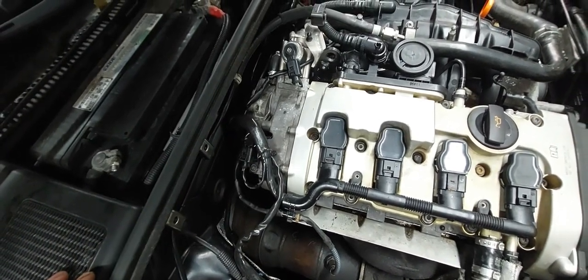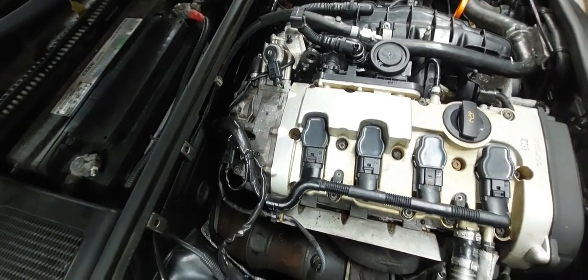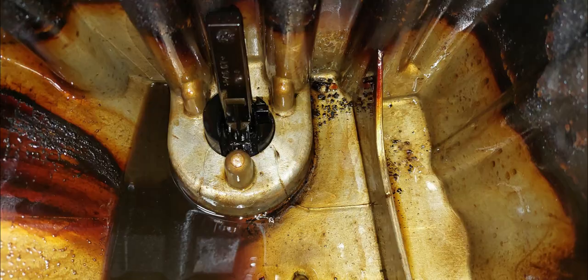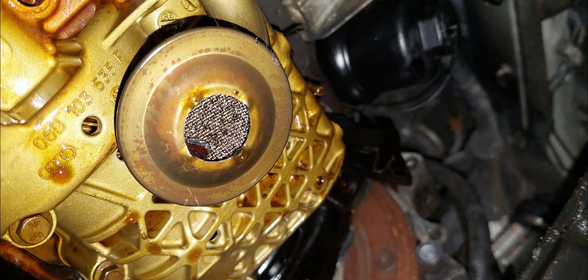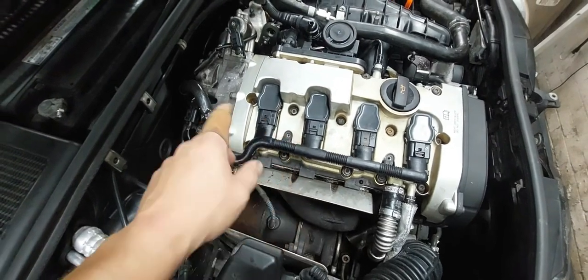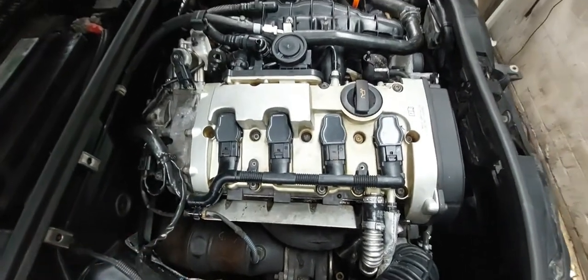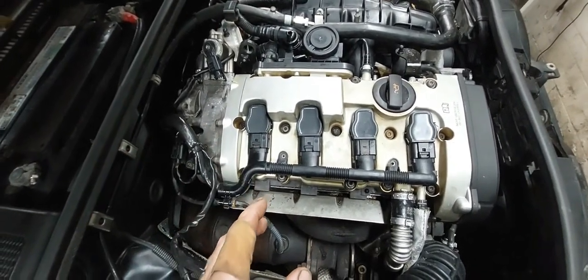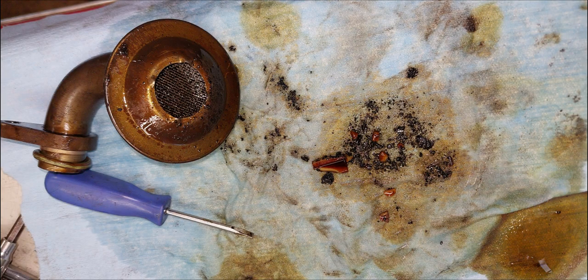The first was the oil pressure on this thing was dropping as the engine was running. Generally when you have an issue like that, the engine is either a sludged engine or there's debris getting clogged up in the pickup screen. I know when I had the valve cover off it looked a little dirty, but it wasn't terrible. Long story short, I ended up having to drop the oil pan and clean the pickup screen and clean the oil pan, because there was a lot of the broken plastic pieces that actually got sucked up into the pickup tube with the oil pump and was restricting the suction side of the pump, therefore not letting enough oil come up and giving me a low oil pressure issue.